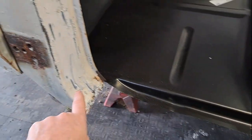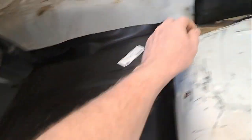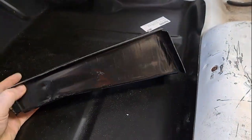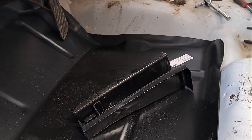So now I'm gonna finish cutting this floor out and start putting my inner rocker in so I can put this piece in. I got the A-pillar cap support for this side - I gotta put this in too for this side. Got a lot of work to do, so I'm gonna get on that and see what we get done.